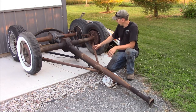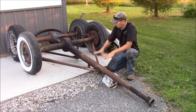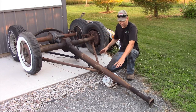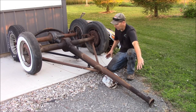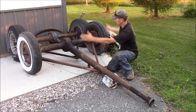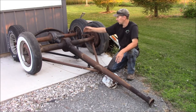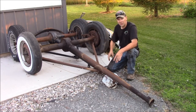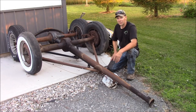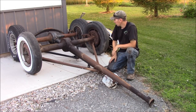So what you got was your torque tube, your radius rods here, which keep the rear end from twisting. It basically makes this whole thing pivot in a triangle. If you can imagine your transmission mount here and your spring mount, it allows the rear end to twist like this, up and down over bumps. This is pretty much a throwback to wagon times when you had a wagon with a transverse spring, trailing arms going up, and a wagon axle. It's pretty much how Ford's suspension was from 1928 to 1948 — it rode pretty good.